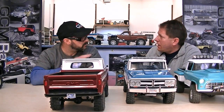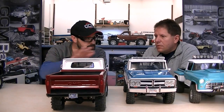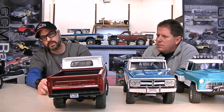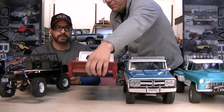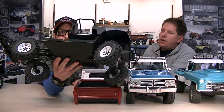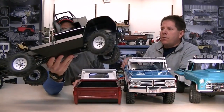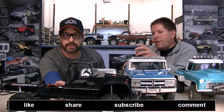If you have me back, I'll bring one to show how I do it. Now what about the chassis — maybe we can lift the body off? Your chassis designs are consistent across all of them. Really well done — let's pop the body off. Here is the chassis that he builds under these trucks — fully custom, fully aluminum. Once I get the body made, I turn it upside down, use cardboard to trace out the inside frame of the truck, then figure out how I want to position my motor.